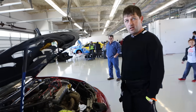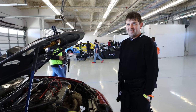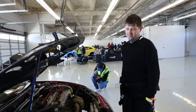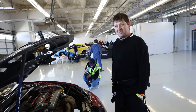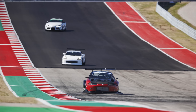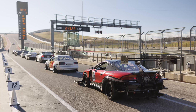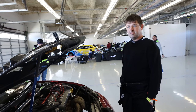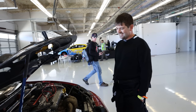How is it that the transmission can handle this horsepower? It's all-wheel drive - got to drive it kind of gingerly. I've owned the transmission for about four years and haven't touched anything in it. That's probably the weakest part of the drivetrain setup, but there's not a lot of options anymore - not many people are supporting this chassis for upgrades. It's a five-speed. I'm running a front-line fabrication brace on the transfer case and rear diff, but all the internals are completely stock - even the rear diff. We went to an aluminum driveshaft this year to lighten up a little bit, but stock axles even. It's almost four times the normal stock power - that is incredible.